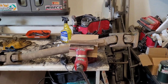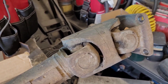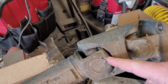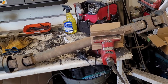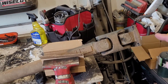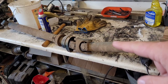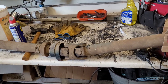I've got the driveshaft for the Riviera up here on the bench for disassembly. This is the double cardan joint — it's more common in the Jeep and truck world and I'd never seen one before. The philosophy behind the double cardan: there's a post on one side that sticks into a ball and socket and it gimbals more truly. The disadvantage is it's really heavy, and from what I understand, these are used when there are extreme driveline angles — which would explain why this short section from the carrier bearing got the double cardan.